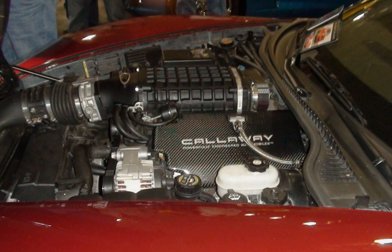The traditional 5-bolt pentagonal cylinder head pattern was replaced with a square 4-bolt design. The pistons are of the flat-topped variety in the LS1, LS2, LS3, LS6, LS7, LQ9 and L33, while all other variants, including the LS9 and LQ4 truck engine, received a dished version of the GM hypereutectic piston. The cylinder firing order was changed to 1-8-7-2-6-5-4-3, so that the LS series now corresponds to the firing pattern of other modern V8 engines, for example the Ford Modular V8.